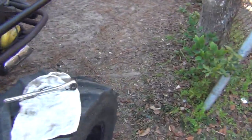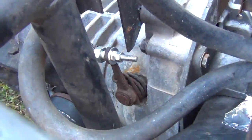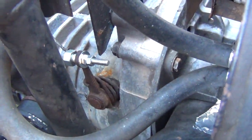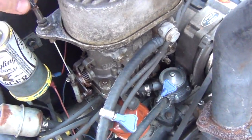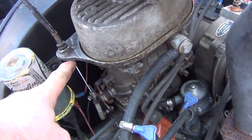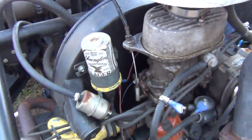We've got the motor in — motor is all assembled. Right down there you can see the shortened clutch cable adapter that got put on the end of that cable. And back here we have the throttle linkage. This is all working. This is a little silly, but this is how it came to me. I might go and put that nut on the other side here so I can tighten this down and stop it from jumping out or binding up.